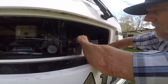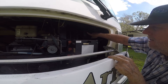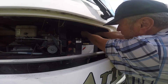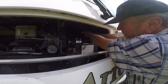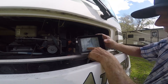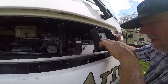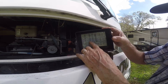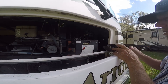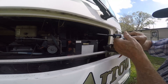I looked around and this is the external fuse block that we were dealing with. So I put my test light there. There's an ear on both sides — you depress them and you can pull this out. Under here is a layout and right there is the stop hazard. It's a 20-amp fuse right there. That's the most likely source of the problem. But if you're not sure, you can go through and check each fuse with a test light.